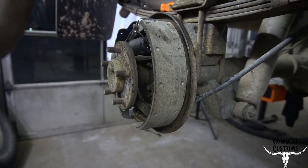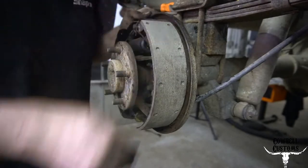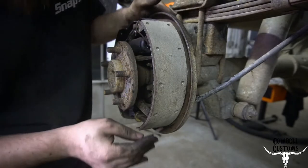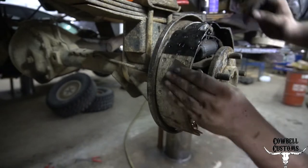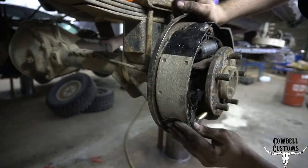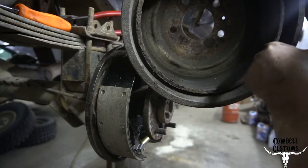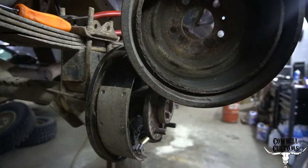Before I throw the drum back on, I always take a piece of sandpaper — let's do 150 grit — and get rid of any fingerprints. This helps in preventing grease contamination; if grease is on there it can cook and glaze, so overall this will help a little bit. This shoe is considerably worse but the sandpaper comes right off. I did not get a new drum and I'm reusing the old drum, but I'm going to go up and hit this with a de-burr tool to knock some of the crap off the ridge, and then hit it briefly with a piece of sandpaper to rough the surface up a little bit.